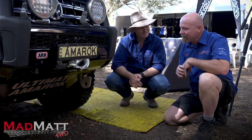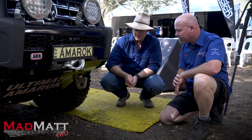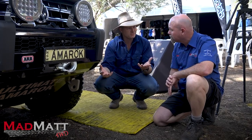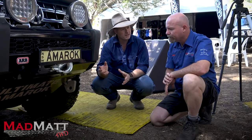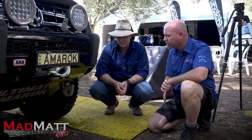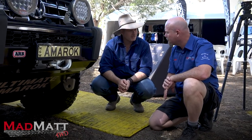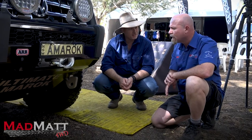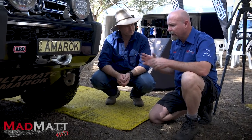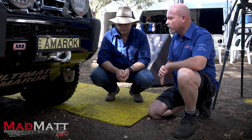We're not going to put anywhere near 20 tonnes in a recovery unless we're using one of those military trucks. What's interesting is the fuse design in the recovery point — he's got a number of mounting points, and one of those bolts is actually designed to shear first, giving you an early warning system. It says 'you've got a problem here' without letting the whole thing turn into a lethal projectile. Getting that warning that something's going wrong is so important — that's why I keep banging on about avoiding snatch recoveries, because of that uncontrolled energy release.